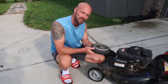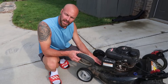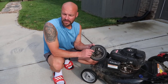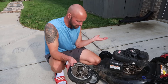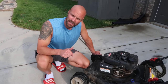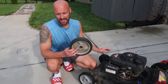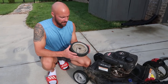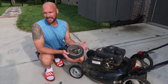For 25 bucks, if your self-propelled doesn't work on a front-wheel-drive mower, first check the belt - make sure it's not too loose and that when you engage it, it stays tight and isn't broken. Then look at your front wheels and make sure the sprockets in the wheels and on the mower itself are spinning. I'll put a link in the description to the wheels I got off Amazon - 25 to 26 bucks, a pretty cheap and easy do-it-yourself fix. Just make sure you order the right wheels so you're not returning stuff. That's it, see you next time!